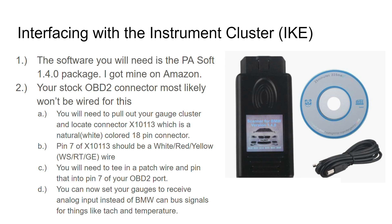The whole idea behind this is that BMW produces these cars in many different countries and oftentimes they need their gauge clusters to match whatever's used in that area — in the States they want miles, in Europe they want kilometers — and they need to be able to switch that on the fly. It also allows you to toggle between digital and analog signals, so you can either get your input for the gauge cluster from the CAN bus like the DME for speed and engine temp, or you can go to the old-school analog system. Those analog pins still exist in the IKE, so if you need a straight signal wire for each circuit, you can switch to that — which I thought was just brilliant.